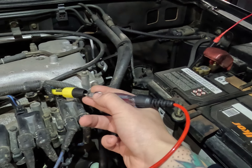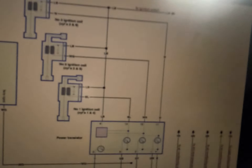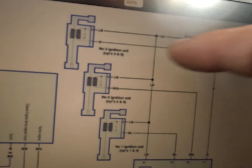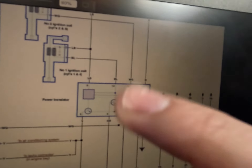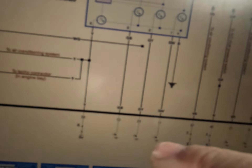We should have a flashing control signal — this test light should be flickering. Now, how this circuit works: we've got coil number three with a shared feed on the LB wire, that's a shared 12-volt feed to the ignition switch. Then the brown wire goes down to our power transistor, which is an ignition module. One side of that transistor has ground and is controlled by another transistor in the ECU.